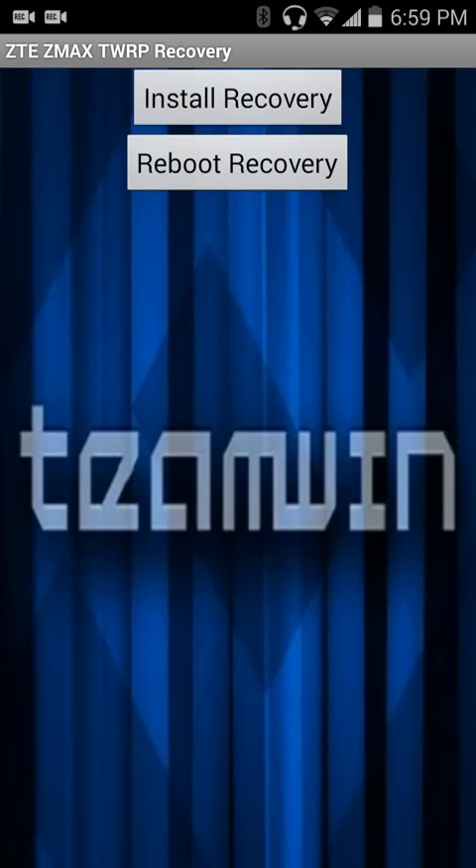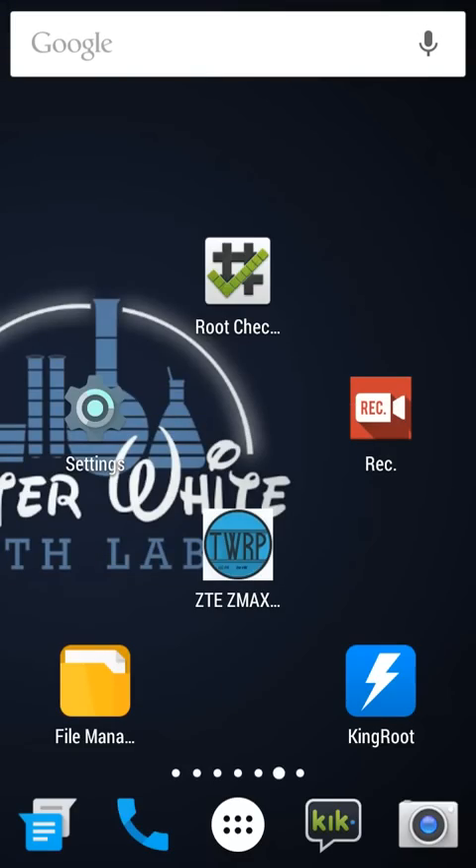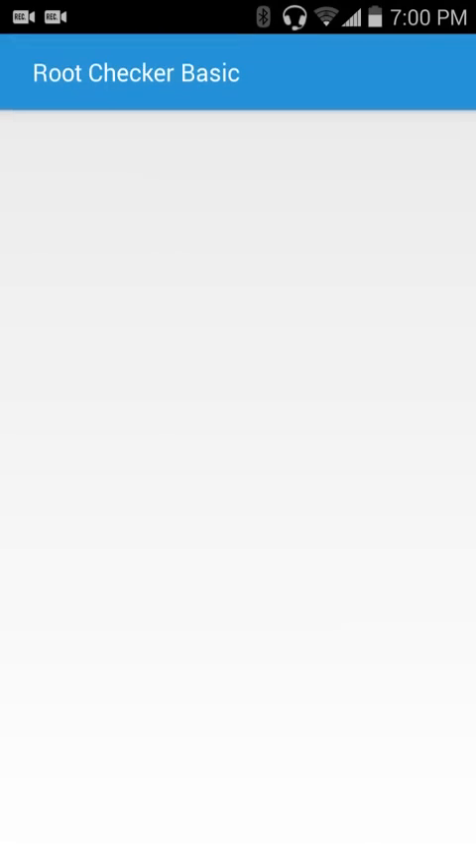After it restarts your phone, it's going to boot you into TWRP. There's going to be a Reboot button down in this area — you're going to click that. And then over here there should be a Reboot Recovery, and you'll click that. Now, it should ask you if you want to install SuperSU. You're going to hit yes and just let it do its thing after that. And then once you're into your phone, in theory you should be rooted and ready. At least that worked for me.